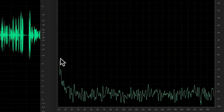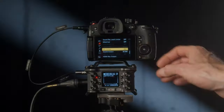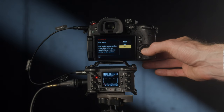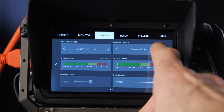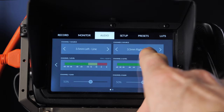Overall I think that's an acceptable and workable level. I missed this in my original review last year because I used the Panasonic GH5S with the input socket set to line level — with line level it's not a problem. So if you're working with a GH5S or a Pocket Cinema Camera 6K or 4K, which also support line level input, you're good to go. But if you're working with any other consumer-grade camera that has a 3.5mm microphone-only input, that's when you'll want to use an attenuator cable like this. I hope that was helpful — leave questions below, subscribe, and we'll get you more great videos on improving your lighting and sound for video.